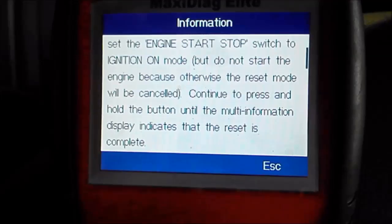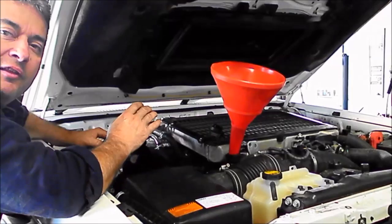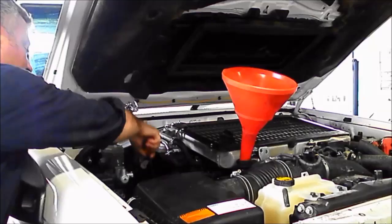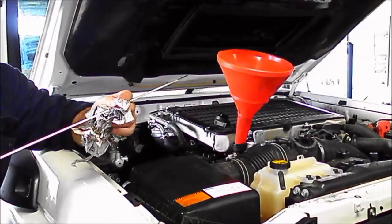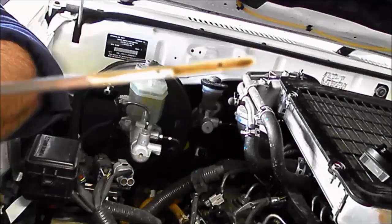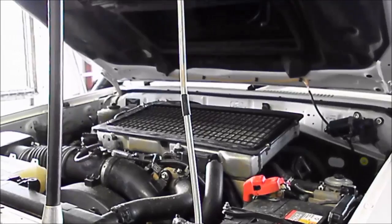Alright, now we'll just go ahead and do that. We've just topped up the oil — put in a little bit less than what was needed, since it's a lot easier to top it up than to take a little bit out. When you're checking the oil, just wipe the dipstick off first. You can see it's just a little bit below the top mark, so we'll just top that up a little bit more. That's the service on a Land Cruiser 200 series, 2011 — I think it's a 4.5 litre turbo diesel.